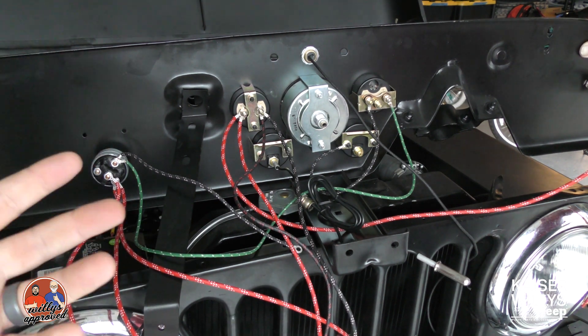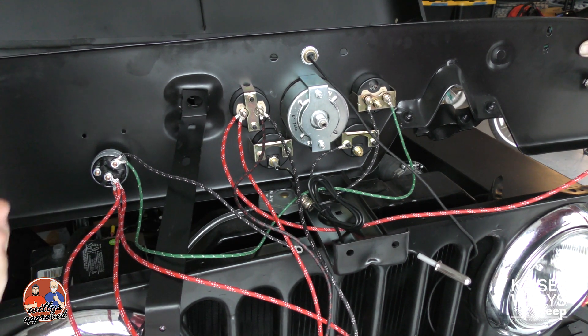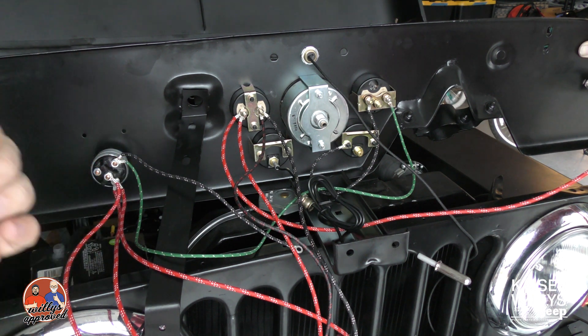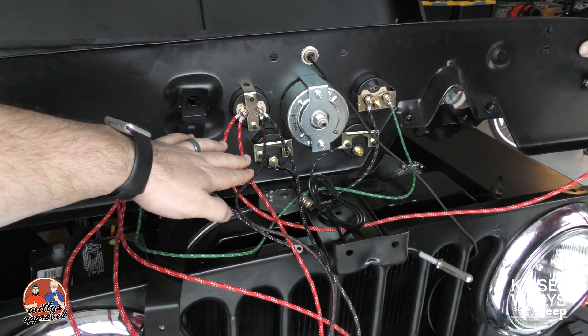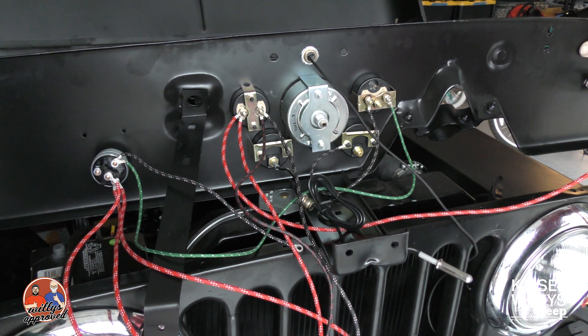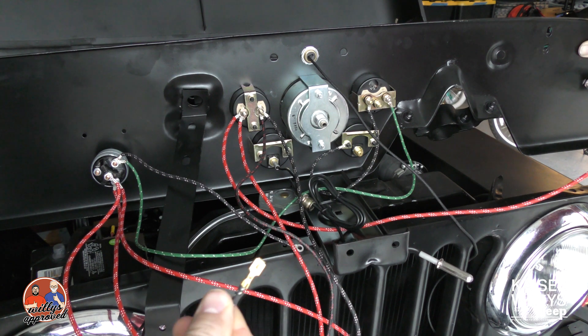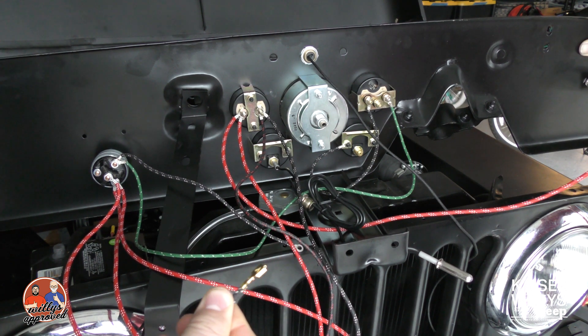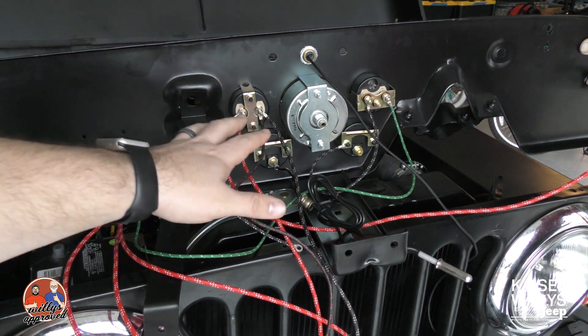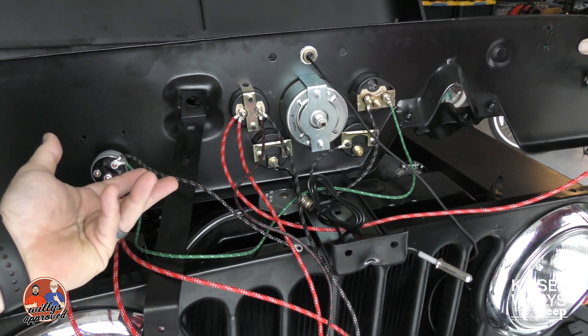That's the change for the gauge in the dash — upgrading from an amp meter for six-volt to a voltmeter for twelve-volt. It's a really easy process. The harness we sell may require a couple of alterations: you've got to change the ends from ring lugs to push-on blade terminals, and you may have to change the way power jumps through the headlight switch. Outside of that, it's a pretty simple upgrade. I hope this helps — thanks for watching.